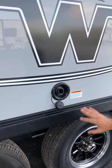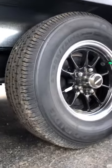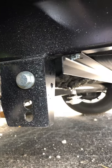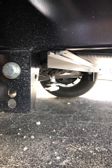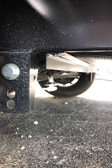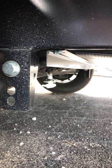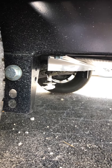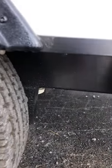When you're traveling, you definitely want to empty the tank. It's actually behind this wheel up here — you see that little white lever? If you flip that valve down, it'll drain out the water. Before you go on your trips or leave your trips, you want to drain your water, because all that extra weight is going to bow out that container and snap the belts and rip it from the underbelly. Unless you're going on a trip where you know there's no rest stop areas for a hundred miles — then maybe have five or ten gallons of water in there so you can use the restroom.